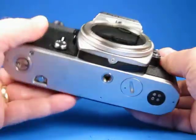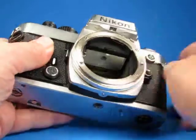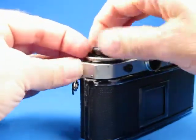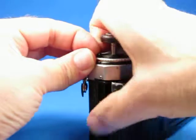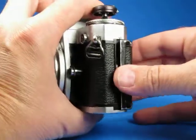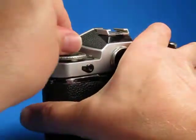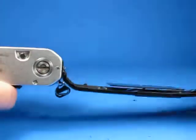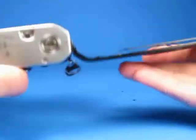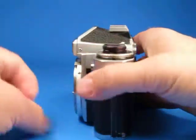I'm still calling the camera 'for parts or not working' because the light seals are all bad — the foam up here looks pretty rough. One other thing you might notice is that when the back is opened, it doesn't always match up exactly right, and you have to push in on the end just a little bit to snap it shut. Most likely that type of damage comes from having the camera open and pushing down on it a little bit to bend it too far, so just be aware that it takes a little bit of knowing how to push it shut.